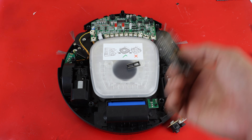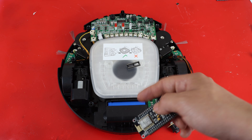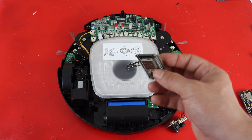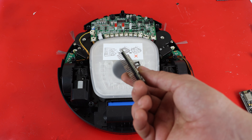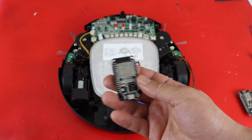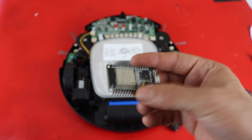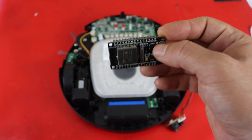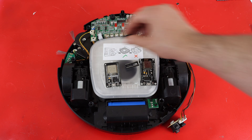Essentially this is a battery-operated device. Also, NodeMCU does not have enough pins to control every functionality. But I think we can get away with it if we don't use some of the LEDs. We can solve this pin issue by using ESP32 boards, which have enough pins. On top of that, you can also use the Bluetooth functionality — it might be fun to control your vacuum robot with your phone like an RC car. But ESP32s are not naturally power-efficient either. So if we decide not to use the WiFi functionality, I think Nordic Semiconductor microcontrollers, like for example the nRF52 series, would be pretty good for this solution. Please share what you think down in the comments, especially about the microcontroller selection, so I can continue with my next steps.